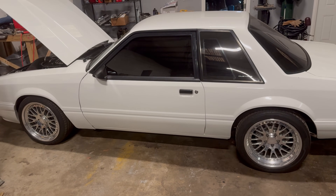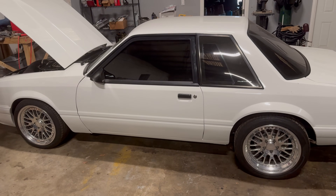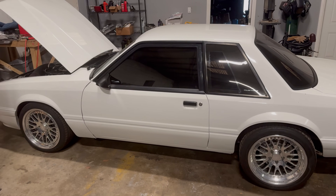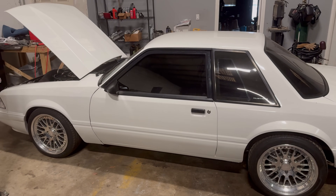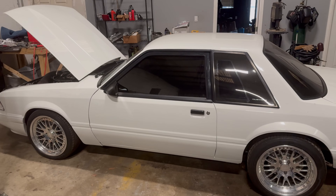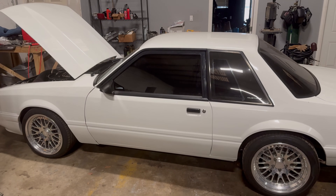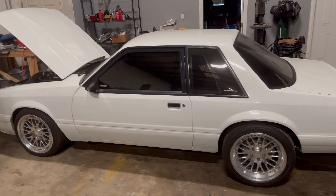Once again, this is my swap — it runs good, it's tuned with HP Tuners. I had to recalibrate the mass airflow sensor for the JLT cold air to make it run right, plus I deleted the IMRCs in the back, so there's a little bit involved in that as well.